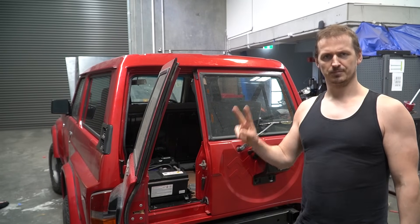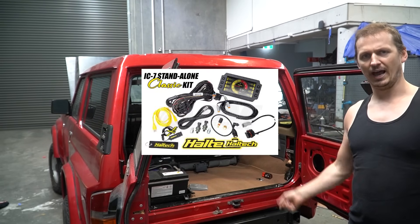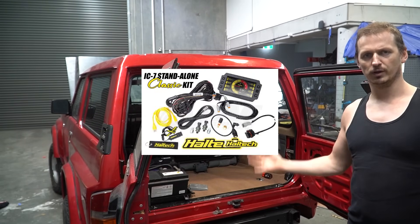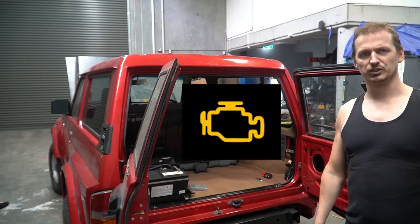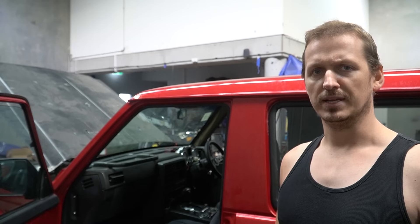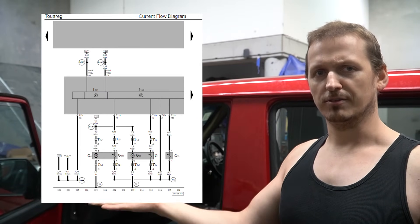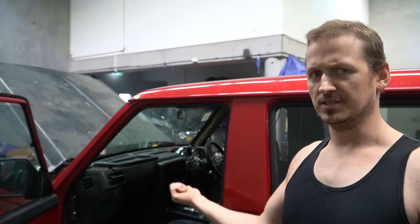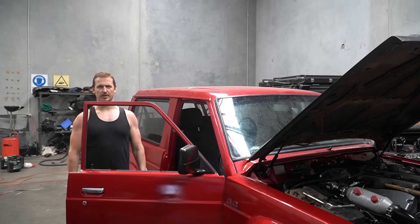And what this means is, out of the box, that speedo does not work with this ECU, or set of ECUs, or set of modules, or CAN bus system. Which gives me two options. One option would be to use the entire dash as a standalone unit and add my own sensors like coolant, whatever — and this would be a really crap idea, because it would completely eliminate the stuff that gives you check engine lights and useful information. The other option is to do something quite terrifying: butcher the entire wiring loom, somehow find the relevant CAN bus circuits, and then tap those into the Haltech display. And that is why this is something I'm going to complete in the background, because nobody wants to see wiring.